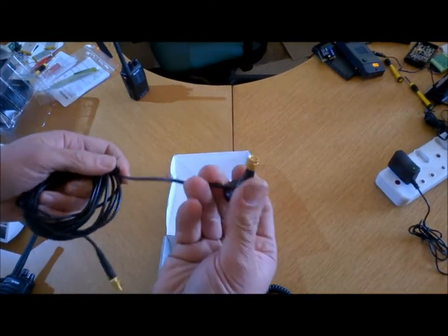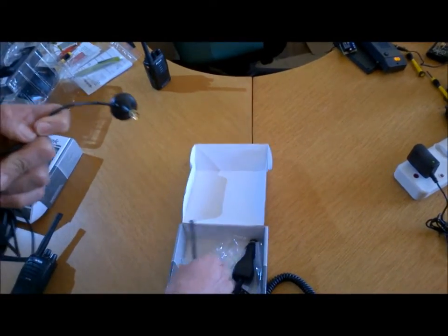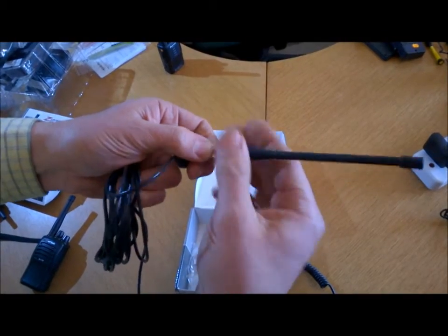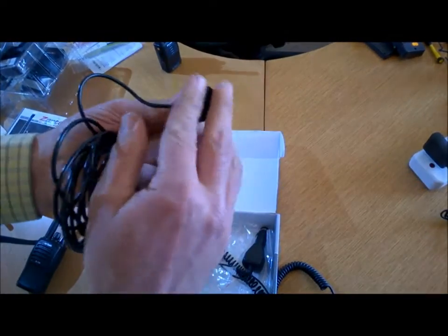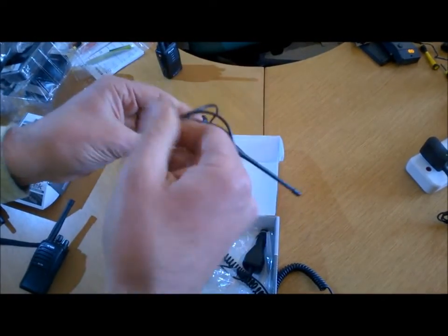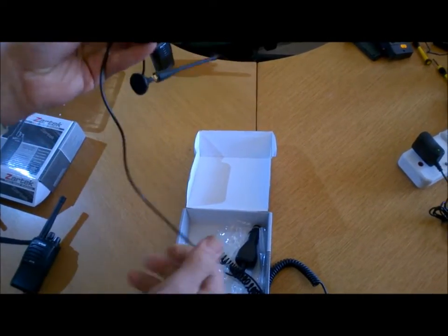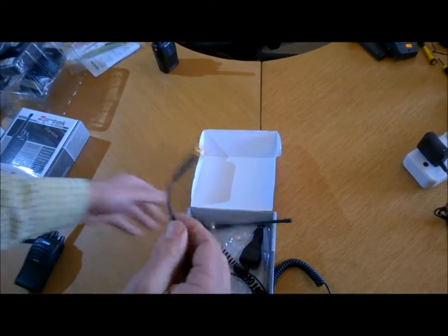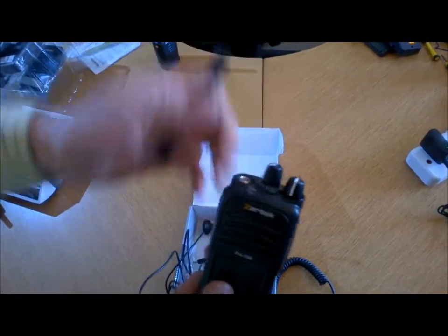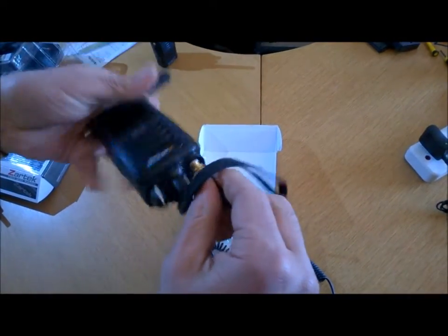The external antenna comes with a magnetic base, 3 meters of cable, a rubber antenna that gets connected to the base. The magnet has a felt pad that can be fitted onto a vehicle. The wire should be fed through the door, and the door can be closed on the wire. Remove the antenna from the radio and insert a cable instead. This improves range.